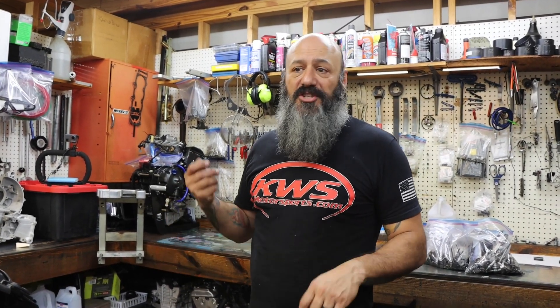This is not a street bike where they want you to put 500 miles on it. If that were the case, we would never be racing — we would just be breaking in motors all the time. Once you get a little bit of time on the dyno and the second I go wide open and we're still good, you can go wide open. The motor is going to naturally seat itself in a little bit over time. The reason they want you to do that on stock bikes is they want you to bring it back in to get that first service.